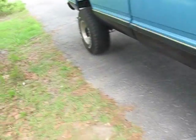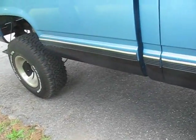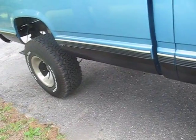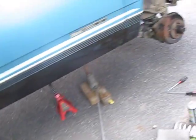I can do this to the backs too. I actually just did the backs, and they read within one degree of each other, so that's not too bad. But ideally you want to go out and go for a really hard drive — maybe 20 minutes, really lots of braking — and really warm up all those brake parts. Then you can really see the difference.